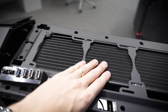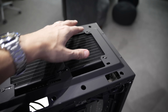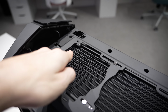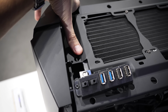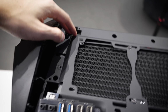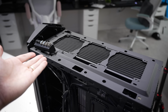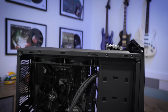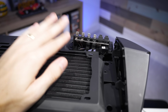Now I was wondering during deconstruction why the owner didn't have 2 screws toward the front of the radiator, so I haven't installed most of them. I've got just 4 of them holding it up right now. But there were 2 missing, and the reason why is actually because this radiator slopes downward toward the front of the case because it is being impeded by this little section here of the chassis that angles downward. You can see the front of that radiator there is not liking that. And so as a result, you can't actually use conventional screws to keep this radiator upright. So it's actually crooked. It slants downward toward the front, which kind of looks weird when you look at it this way. Now I see it. I didn't see it before. It's very slight, but just another reason why I'm very happy that we are moving away from this case.